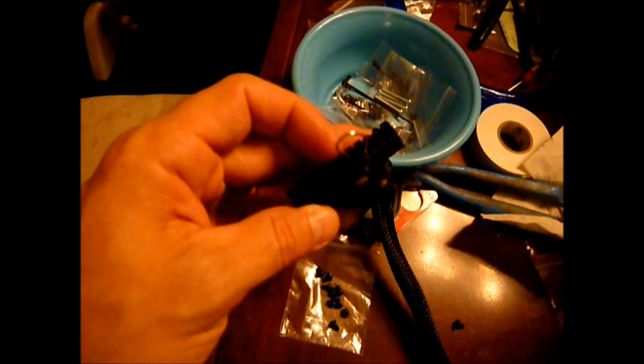I also got the paper clip right here. Now see, the Corsair AX1200 Professional Series has all black wires. You're supposed to run a paper clip in the positive, which is normally the green, and then into a ground, which is a black wire, but they're all black. So I went online and did a little researching and found out that it's, I don't know if you could see it, but it's 4 pins over, the third and fourth from this blank one right here next to my thumb.